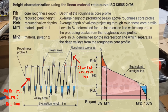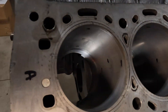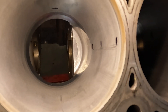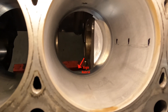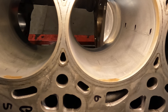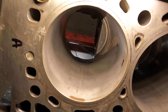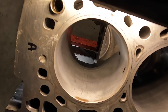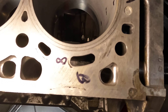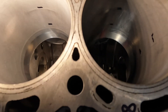You want to have good oil retention — because if you just had a shiny bore like what we have right now, you can see this is just cleaned up. You can see down there — the material at the bottom is virgin material, which is very shiny. The top portion is very shiny also. The streaks you're seeing here are just where I took a bore gauge and measured to get bore diameters, tapers, out-of-roundness, and so forth. Overall, these bores look pretty good — there's not a lot of what's considered bore scoring.